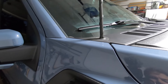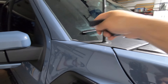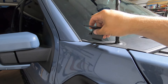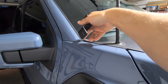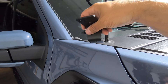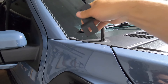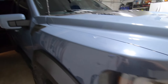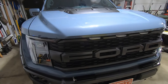Now let's close the hood and focus on our ditch brackets. These are the brackets I picked up from Diode Dynamics — this one's marked R so it goes on the passenger side. Essentially what we're going to do is peel up this little trim cowl piece, there's a 10-millimeter bolt right there, we pull that bolt out, drop the bracket down on it, and re-tighten everything. While you're doing that, throw a piece of painter's tape on the inside edge here so if you nick it with the bracket or any tools you're not going to scratch your paint.